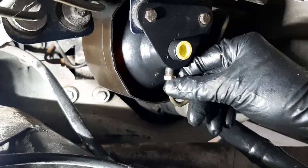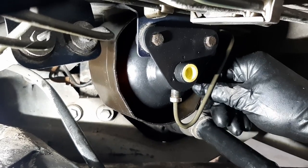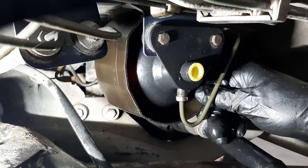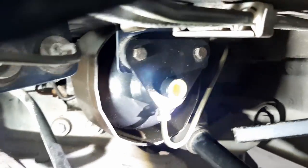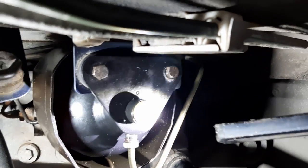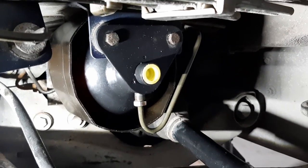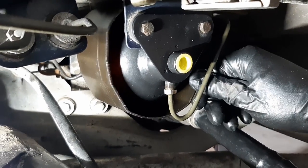So before reinstalling the line fully over here, I was wondering about this, what BMW calls a protection cap, and I don't remember it being so loose on the old accumulator. I thought it was pretty firmly in place, and I'm sure that's going to vibrate as I drive. So I tried to look online for information, but there's nothing that I could find about this cap, and there's only some molded lines in it like this, so it looks like it's a press fit of some kind, but I don't know if the diameter of the accumulator is changed with the Febi Bilstein units, but it's kind of strange, and I'd like to fix this before bolting everything down. I don't want this flopping around, so I'll try to look for a solution and report back.